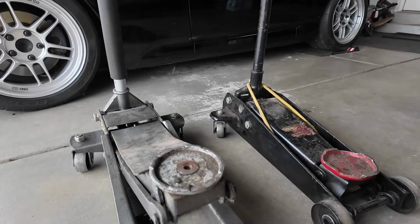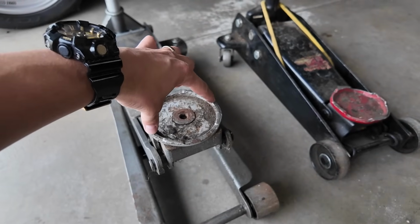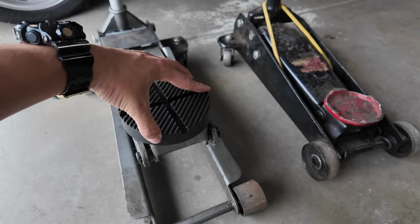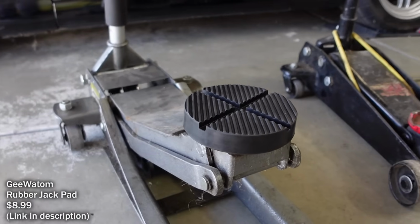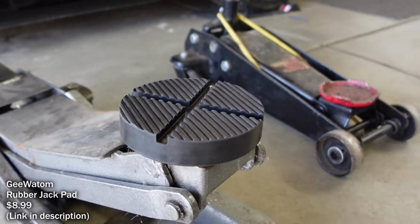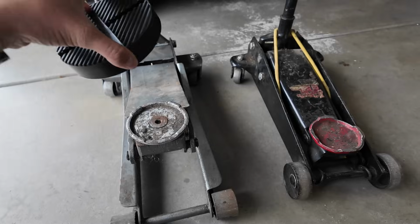Sometimes when you're lifting from like the pinch weld, this contact point is fairly small and it can damage a pinch weld. So stuff like this puck can go on here and gives you a greater lifting area. And so the weight is distributed a little more evenly throughout the lifting plate. Do make sure that you're getting the right size. The one that I have in the description will fit this one.